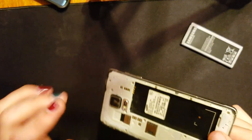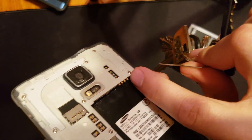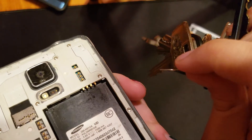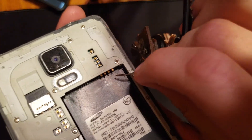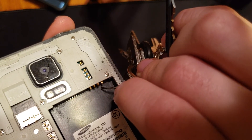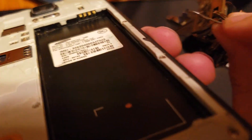I'm not going to force unbend it again because if you bend it too many times it might just snap off, and if it snaps off then the battery connector won't work. The bottom of this pin was actually pushed out of the phone and completely bent in the wrong direction. What I did is I just took a SIM card tool — it'd probably be better to use a plastic pry tool — but I just grabbed the tip of it, which was sticking out right about here, and pressed it back into its slot, back down into the corner where the pin's supposed to connect to the board.